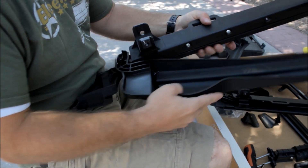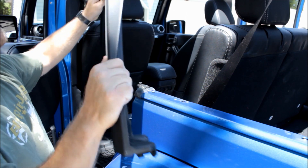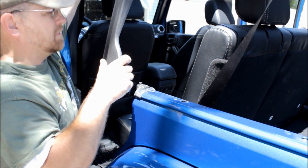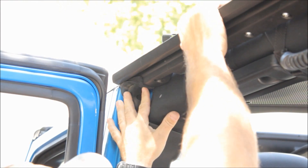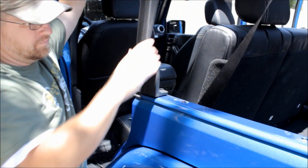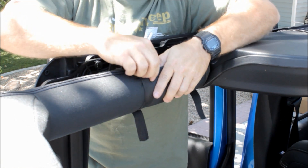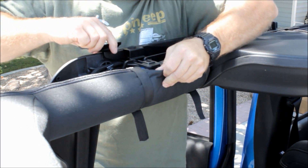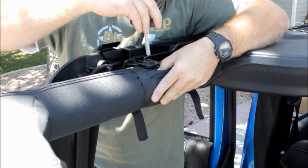With those cable guides installed, put the rear door rails on the Jeep. There's already a hole in the tub that corresponds with a plastic stud on the bottom of the door rail so you can index these correctly. Pay special attention to the weather stripping so you don't get it folded under — it fits down nicely and clips onto the roll cage. The kit includes six threaded knobs: two sets of long ones and one set of short ones. You'll find a slot already sewn into the roll bar padding and a threaded hole already in the roll cage. Grab one of the long sets of threaded knobs, thread it in, but don't tighten it yet. Repeat on the other side.